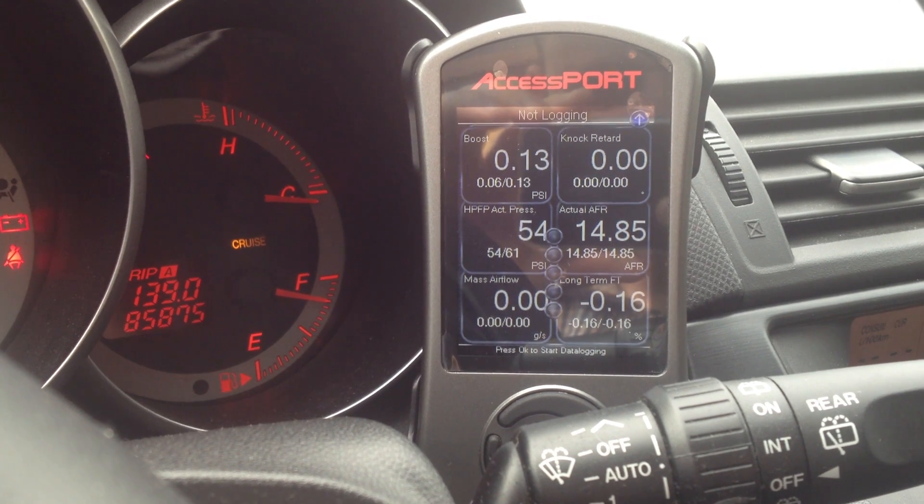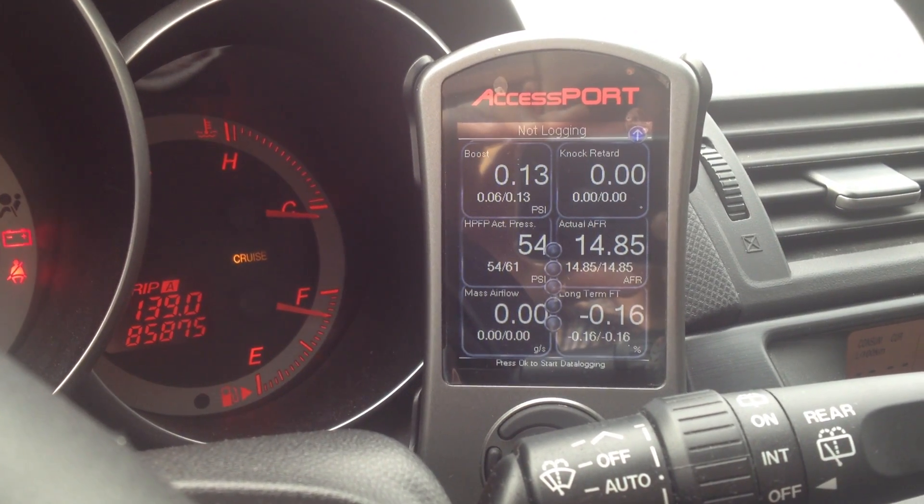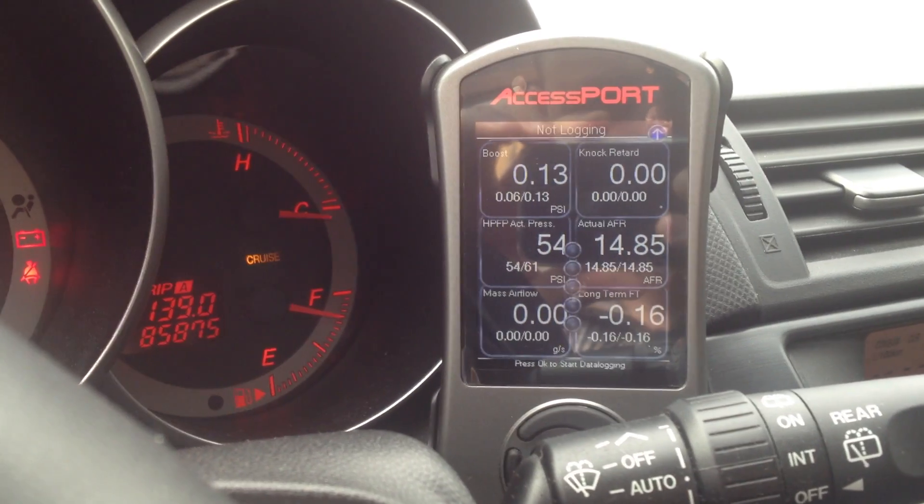As you can see in the data log I made, my pressure didn't go higher than 1355 psi. A good working relief valve should hold close to 1850 psi and should show a log like you see in the picture. So I think my relief valve on my high pressure fuel rail is busted.